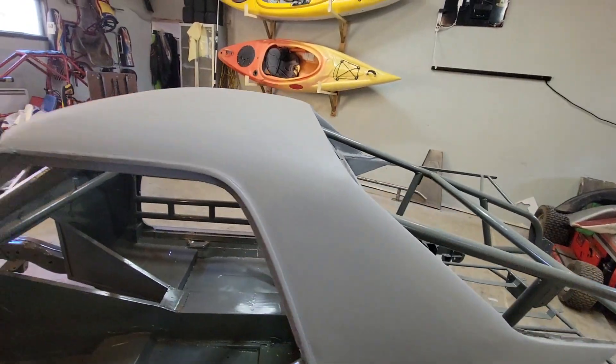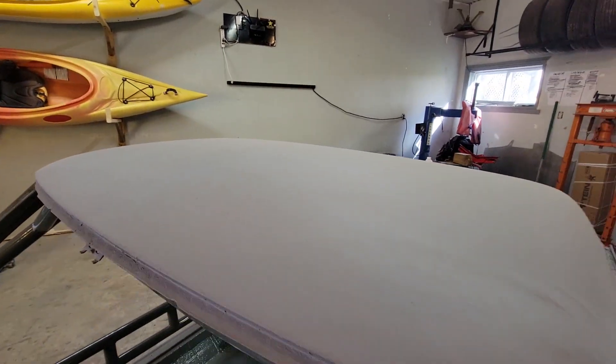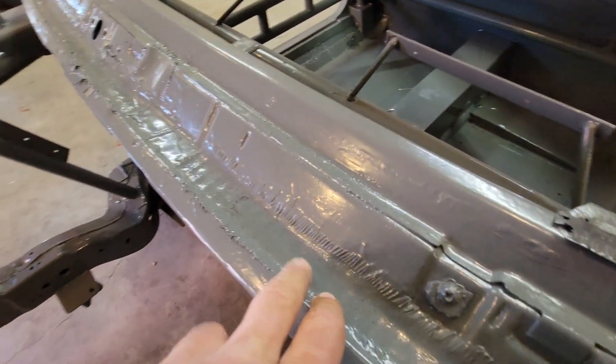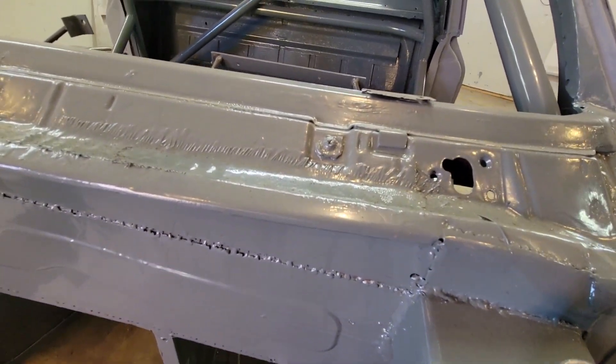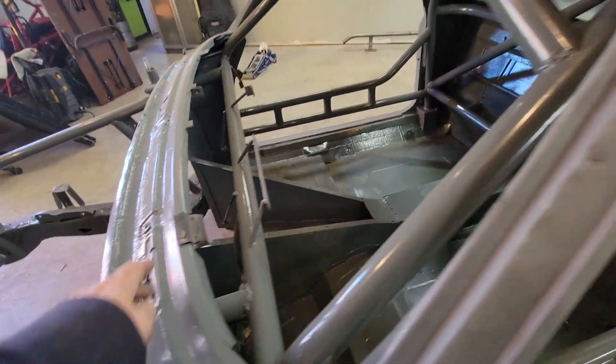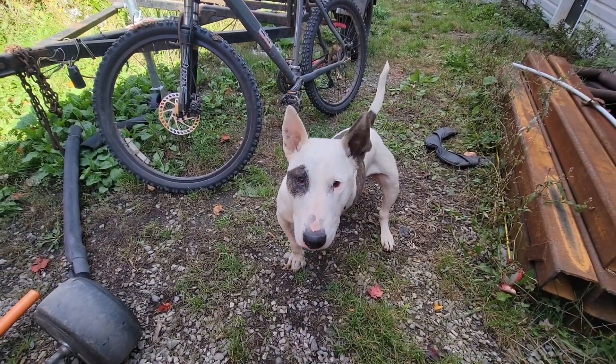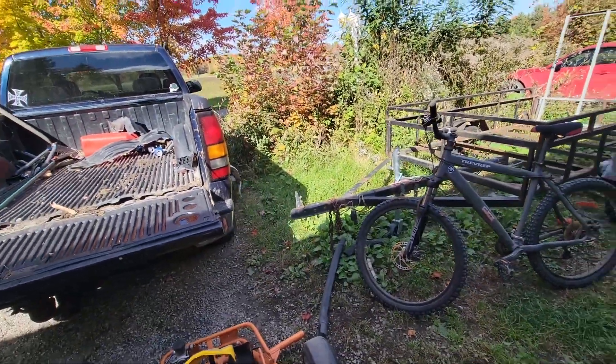I got a little damage here. The roof and everything is good, it's just a little dirty now so it looks a bit off. I threw some fiberglass over here at the last minute because these holes were originally going to the engine bay because my firewall is so chopped up - this would go directly into the cab of the car. After I got the body all primed up with that really high-fill primer, I put a lot of coats figuring I could use that to sand and fix any imperfections. Once the other panels get on it too, I'm sure I'm going to have to straighten up a bit with the doors and fenders, line everything up and perfect the lines.